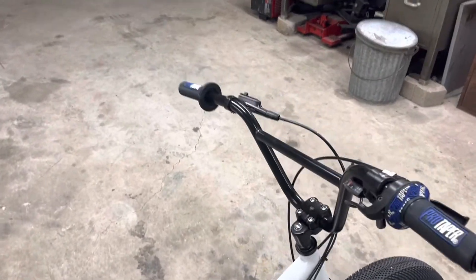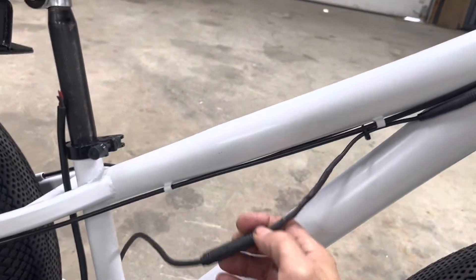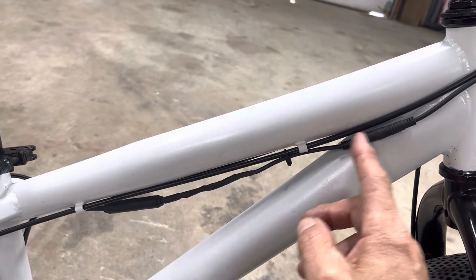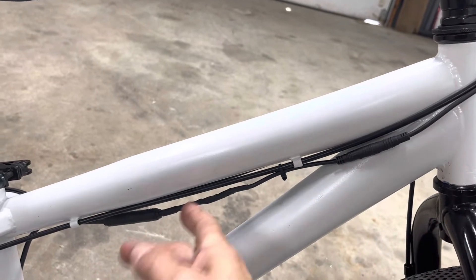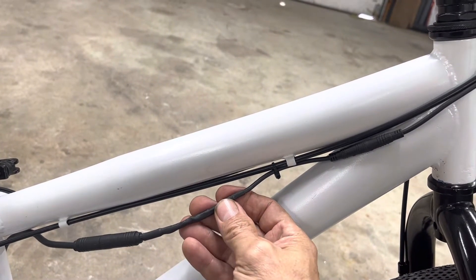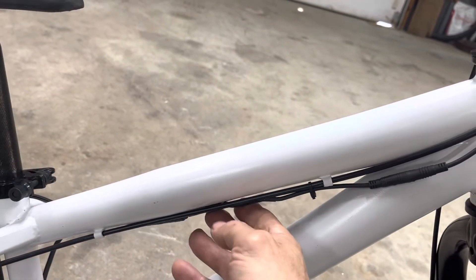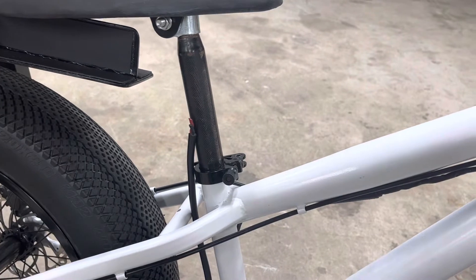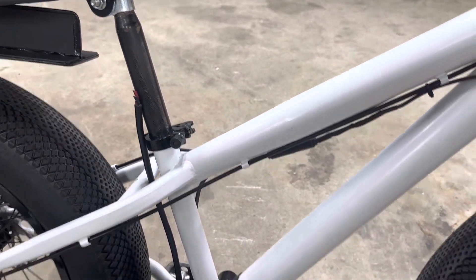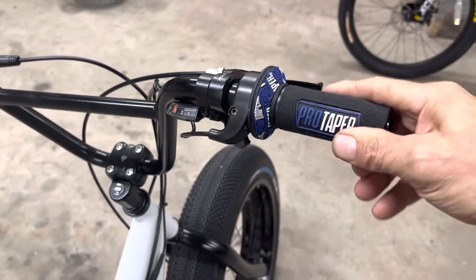I'm running this with no display. What I ended up doing was making a custom wire using an old BBS wiring harness — I jumpered the brown wire and the other one goes to the throttle. The way it works is as soon as you plug the battery in the system is on, in one mode that has no pedal assist whatsoever — throttle only, which I have as a twist throttle.